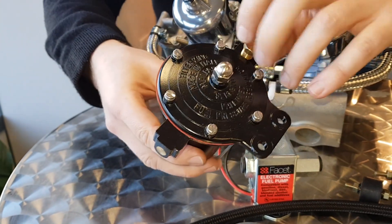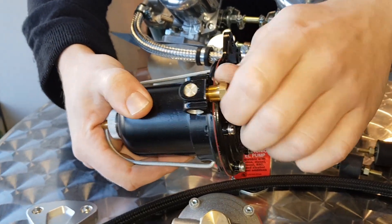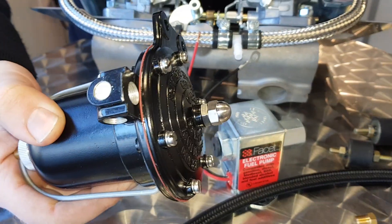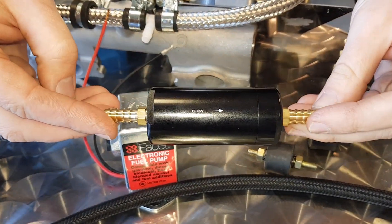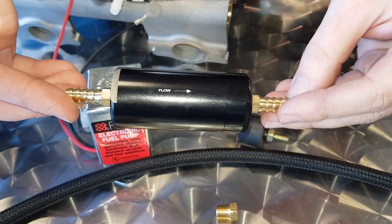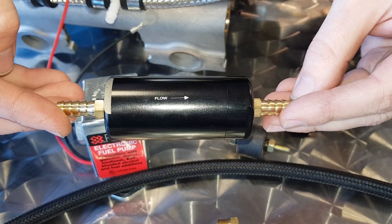That's got a bowl with an inbuilt filter in the bottom. It's also got removable tails, and on this one there's a plug in the top so you can connect up — for setup only — a fuel pressure gauge. It also comes with one of these fast flow inline filters, so put this between the tank and the pump just to filter out any nasties that might be in the bottom of the tank, which will make the fuel pump last a little bit longer.